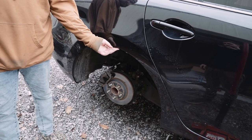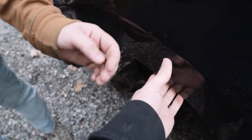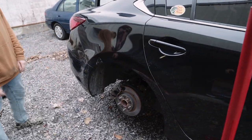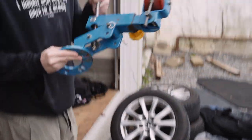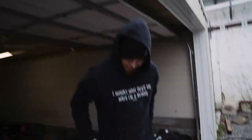If you roll it up it gives a little extra reinforcement. If you cut it, it leaves the metal super thin and weak — but it's easier to pull when it's thin if you need to pull it to fit the wheels. If anybody needs their fenders rolled, hit me up, I got the roller. I'll be at Riverside with the roller — come by and get some fenders rolled last second, Hunter hook it up.